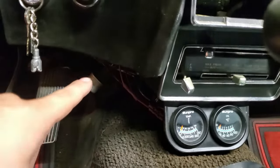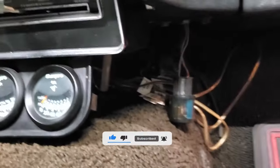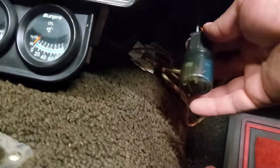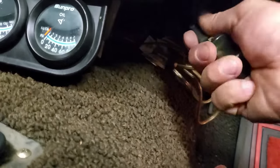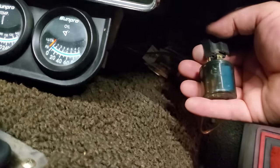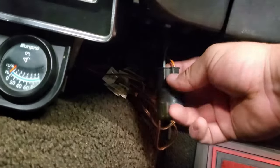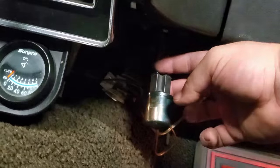This car has two flashers. You have your hazard light flasher on the driver's side, and then you have your turn signal flasher located on the passenger side. If you do not have any turn signals at all, to test this you can remove the flasher — it's very simple, you just pull it off — and all you have to do is put a jumper wire between these two pins. You just basically connect these two wires together.